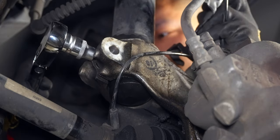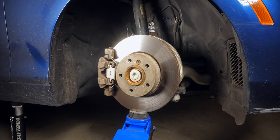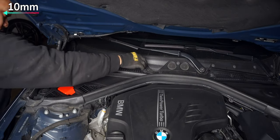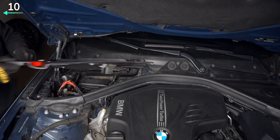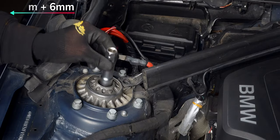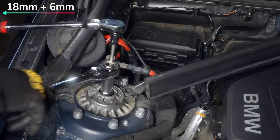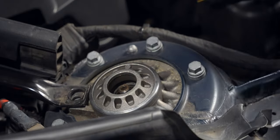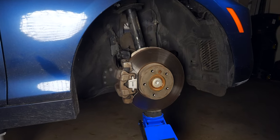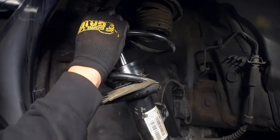Next up is a small specialty tool called a spindle spreader that will slightly open up the knuckle. Now jack up the whole assembly by the rotor or lower control arm and ensure that the jack is locked in position. The top of the strut is under the cowl, which is held in by three 10mm bolts that need a 90 degree turn, and this weather gasket that we can lift out of the way. You can also remove the E18 before we loosen the strut from the top half, which requires an 18mm pass-through socket and a 6mm hex as the counter hold. Once it's out, slowly release the jack — in real time, this took about 30 seconds to bring all the way down. This should allow the spring to safely expand, and if your suspension is shot like this one, then compressing the shock should be very easy once the bump stop is removed.